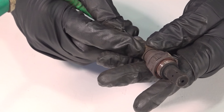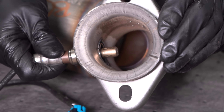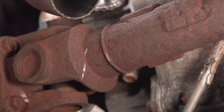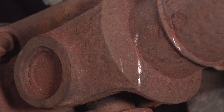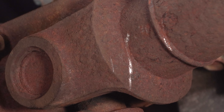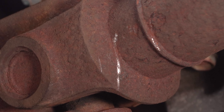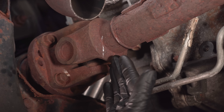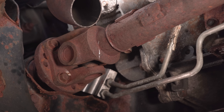It's going to need a wiring harness or at least an extensive repair of the harness to be able to plug in a new sensor. On the other side, they hit the driveshaft here — the driveshaft did get slightly cut by the reciprocating saw. Not enough to cause damage; I can feel the groove, but this is not something that would concern me from a driveshaft point of view. Although if it was a deeper cut, this would create a weak point. Being a four-wheel drive vehicle, if you put force through it, could it break? Maybe. If it were a deeper cut, this would need a new driveshaft as well.